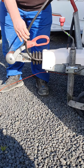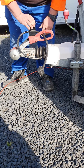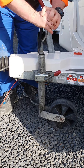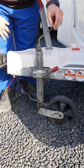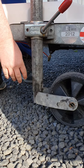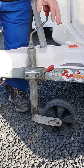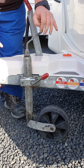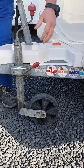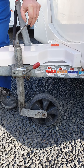You have a standard seven-pin trailer plug there, so it just hooks up to your vehicle. Right behind that, you've got your jockey wheel — just clockwise and anti-clockwise to wind that up and down. There are a couple of wee grooves, one on each side, designed for this part of the arm to come right up into the air, which stops it swinging around while you're travelling. When you're hooked onto the vehicle, you can undo this lever, lift the whole jockey wheel assembly up, and the wheel will sit up out of the way while you're travelling.